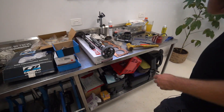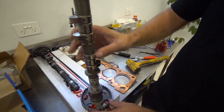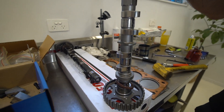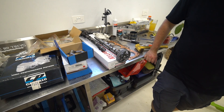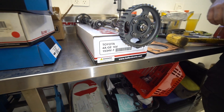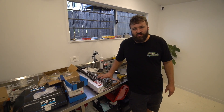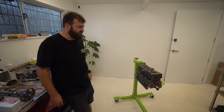We're going to remove the old TRD camshafts. These are TRD camshafts with Hasselgren Racing cam gears and ARP fixtures — 300 degree camshafts from TRD, absolute monsters. For the keen eye, you can see oil holes on the lobes to feed the buckets — that's how much oil was required to try and lubricate them from galling up. We're going to take off the 300 degree camshafts and go back to a 272 Kelford 193 HVT. That'll put us into the RPM range the car wants to run in. We don't want to rev it anything more than 9,000 RPM with the boost pressure we're going to try and achieve. We're looking to make more torque and power down low — hence the turbo setup. It's going to keep our valve train from failing sooner and stop premature engine failure, so this engine should get more life out of it than when it was naturally aspirated.